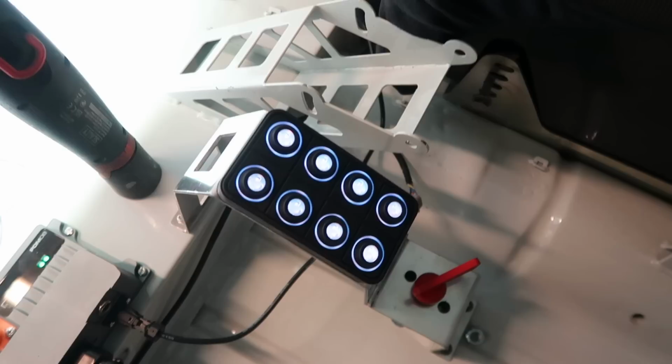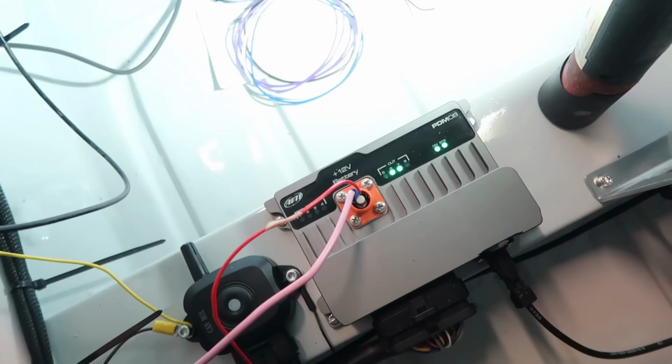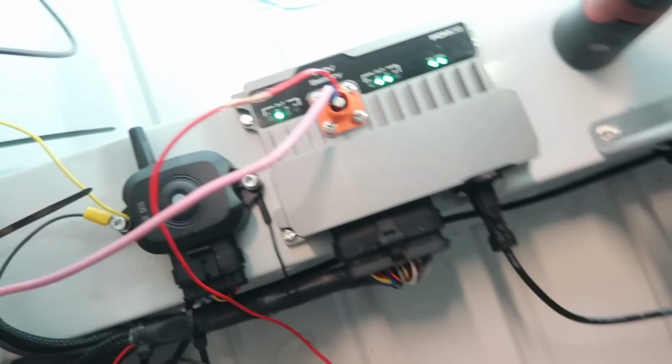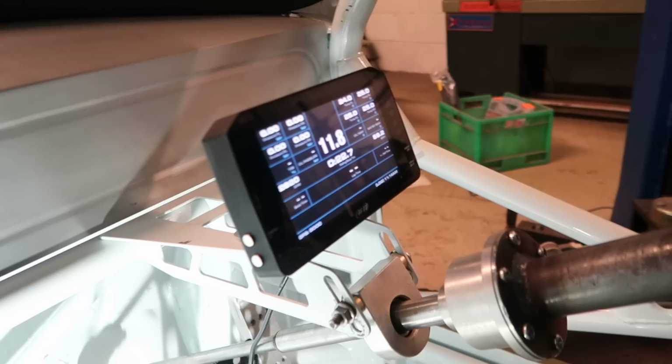It's alive. So I have programmed this, kind of. I know my ignition permanent feed is number 7. Number 2 is my ignition live. This is going to be my ignition one. Changes colour when you press it. Number 2 is now live, so I now know I've got power going to my ECU. I've got information coming up on the dash.